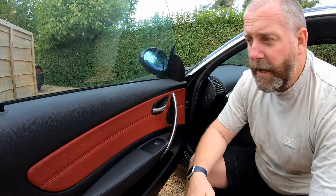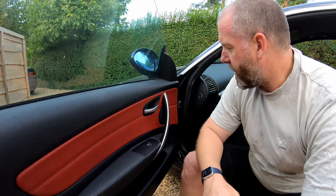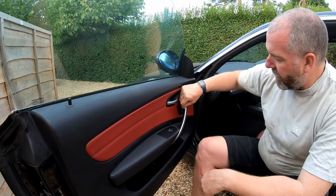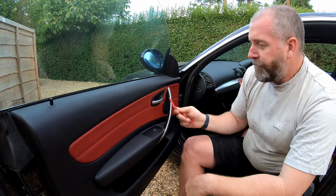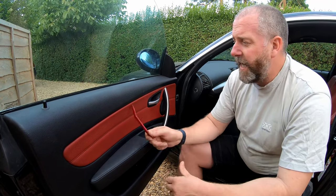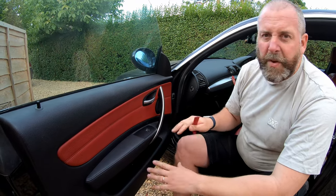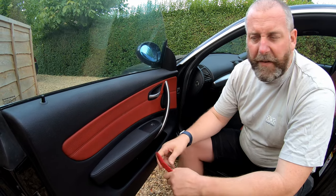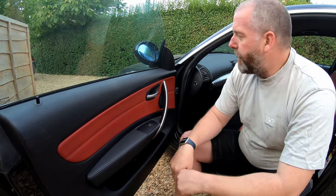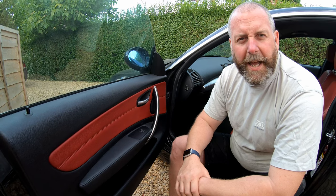That is the door card fitted. As you can see, removal and fitment of the door cards on the BMW 1 Series is absolutely simple. The main advice I would give is for things like the trims, don't be tempted to get a screwdriver out because you will mark them up — a screwdriver is a little bit too aggressive and will damage the plastic. Use a plastic tool, which is actually slightly softer than the plastic you're using it on, and you won't damage the trims. This is for the E82 — the process is the same for the convertible, but the saloon models are ever so slightly different with slightly different door cards, but pretty much identical otherwise. Hopefully you found this video useful — if you did, give it a like and I'll see you all again for the very next video. Take care, guys, bye bye now.